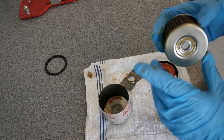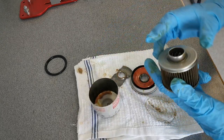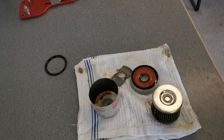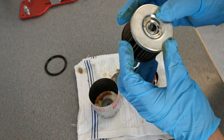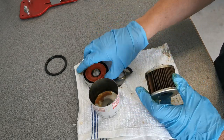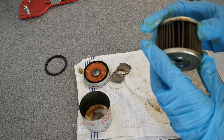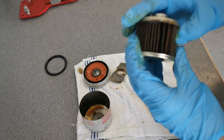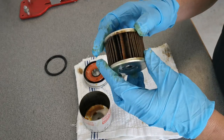Let me give her a little wipe off here, get some of this oil off the outside. We have the release valve. That just broke my pen — live action, right? I got a piece of pen stuck in there so it won't release now. But yeah, this is well-built — it looks like metal ends, always top-notch in my books. The pleats look well-spaced for the filter, but it does not have a steel retainer to keep it together. It's just glued together.